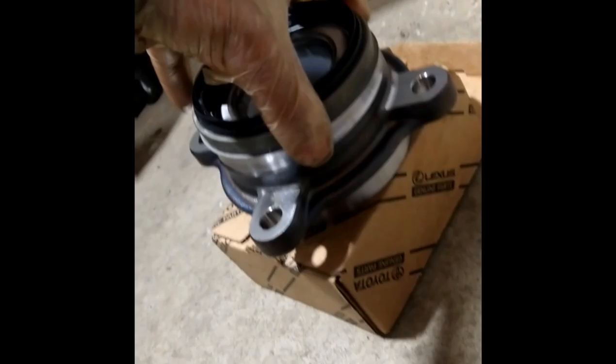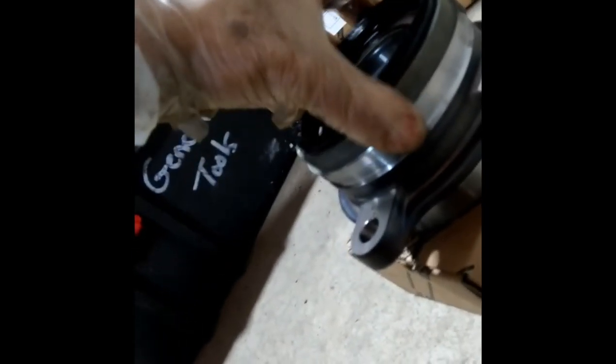Here's the seal for the bearing and hub side. You can see you have this nice flat groove — that's where this seal seats. You've got the other side with the O-ring. I'll give you the part numbers so you guys get an idea. I'm just going to go on there, put a little bit of Schaefer's grease around here, put the seal on, and just tap it in with the center punch gently — it pops in pretty nice. I already got the O-ring installed. You just loop it around, just like a cartridge oil filter, loop it around and seat it in the back. And that's it.